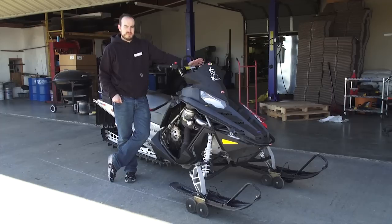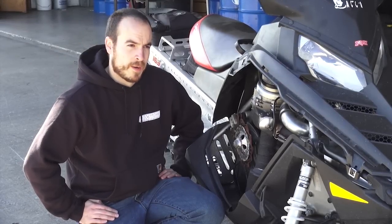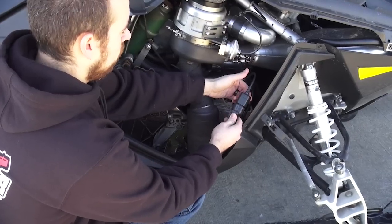It's a real simple process — the same process whether you're on Arctic Cat, Polaris, or Ski-Doo. You're going to want to recalibrate your air fuel ratio gauge outside. When you store your sled for the summer, the summerization program puts a lot of oil on the crank, which is great because it keeps everything lubed up and you don't have to worry about rust. But the first time you start your sled every fall, there's always a ton of smoke, so we're going to do it outside so the breeze can carry away the smoke. The first thing we're going to do is remove the oxygen sensor from the muffler and disconnect it from the wiring harness — we don't want it to see any of the smoke from burning off all the additional oil.